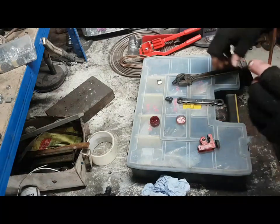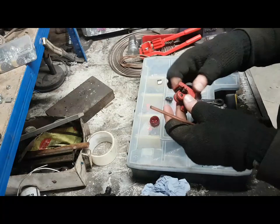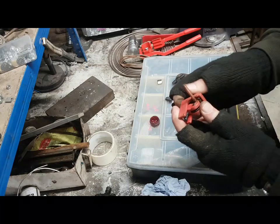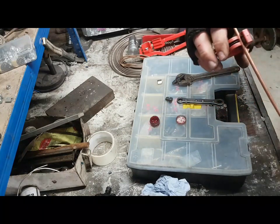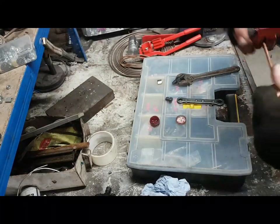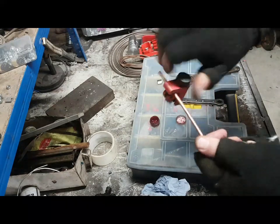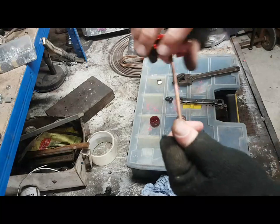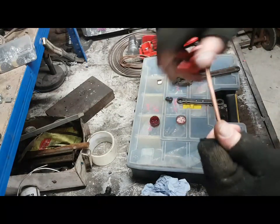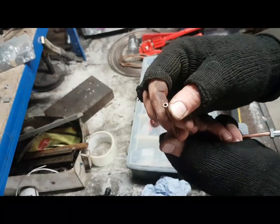Right, next, let's do cutting. These little things, pipe cutters, brilliant little devices. Open them out. Measure the pipe to exactly where you need it to go. Put him on lightly, and that's probably going to help if there's a bend in this. That's how I bend the pipe, to be honest. Cunifer, so easy to work. Wind him round, tighten him a quarter of a turn, and repeat. And eventually it goes through the pipe. A nice, clean, burr-free, swarf-free cut.